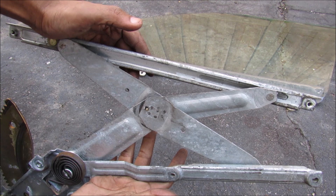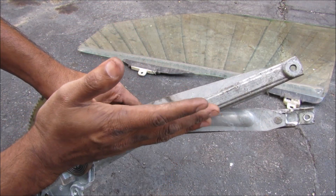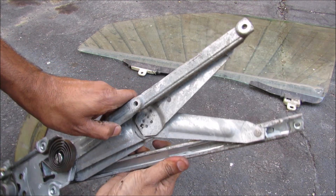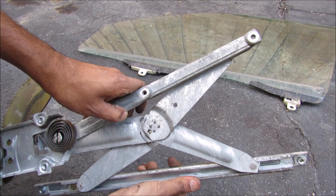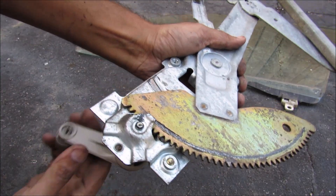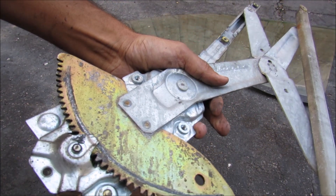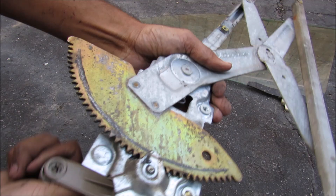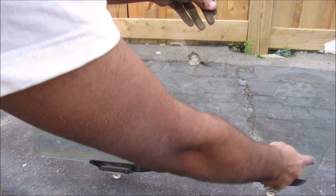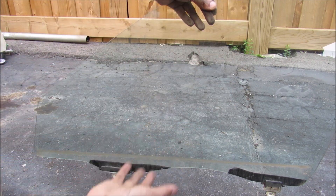Because the scissor mechanism is out of the vehicle I can actually move it pretty easily with my hand. You can see that when I reach the maximum point of the scissor I can actually continue going to the other side to lower the window even further — that's unlike an actual scissors when you're clipping something. And over here you can clearly see how the gear from the crank will engage with the sun gear to turn the big arm to move the window. The window itself has a back edge and a front edge that glide in the window track in the door that we saw earlier.